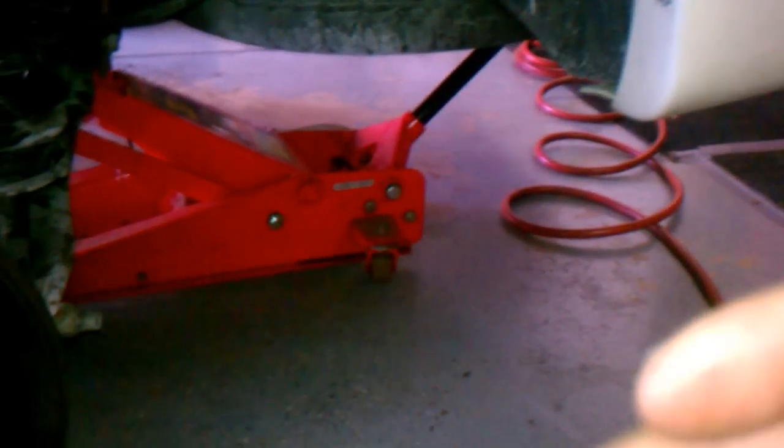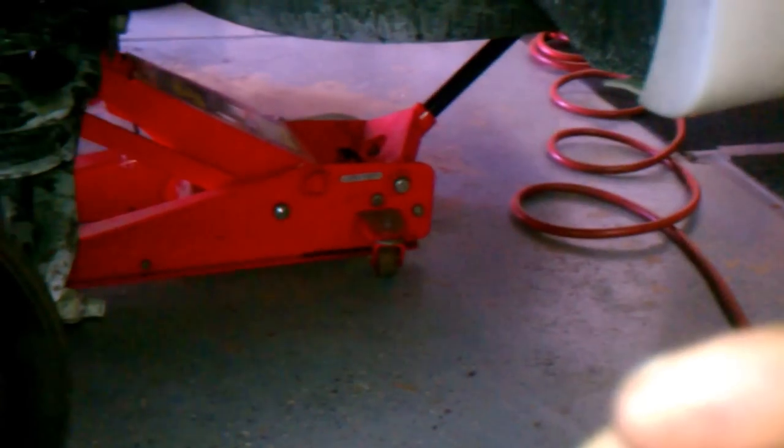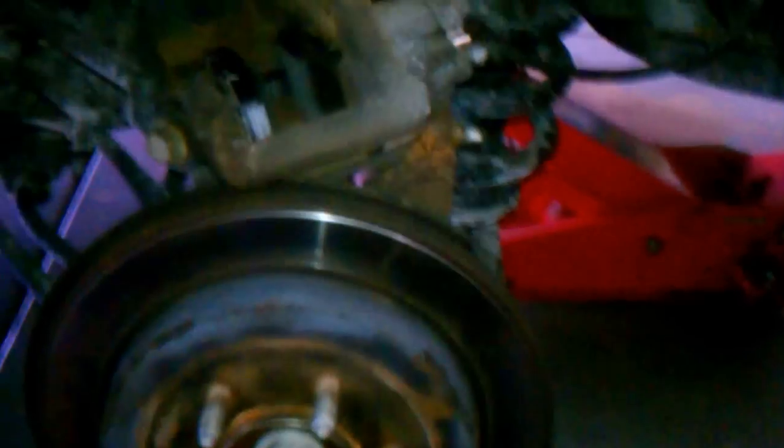and allow you to remove the brake pads and put them back on. We're going to see, I believe, one of the blogs said 10 millimeter, but what I have here in my hand, I don't know if you could see that or not, it's a 7 millimeter Allen wrench. 7 millimeter Allen wrench. All right. That's what takes those little pins off on an 07 Ford Expedition rear caliper to get the brake pads off.